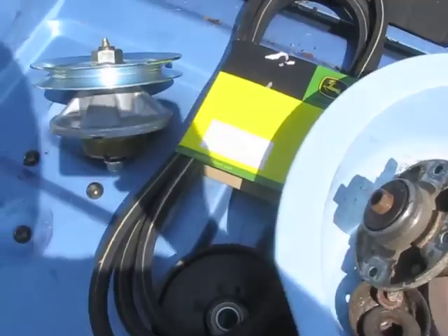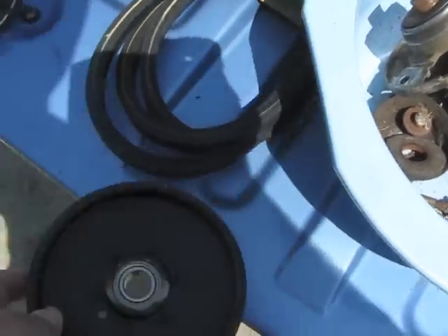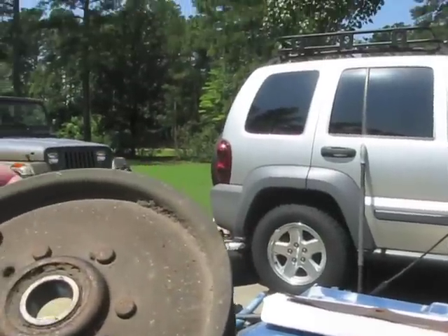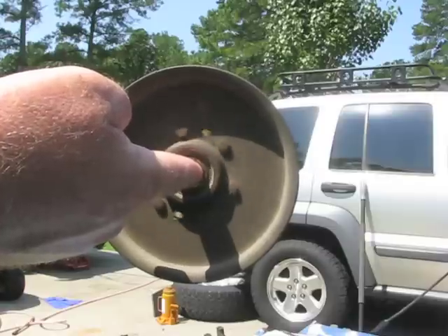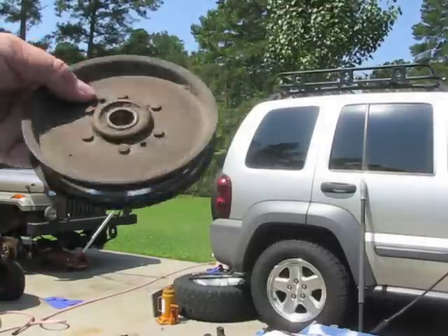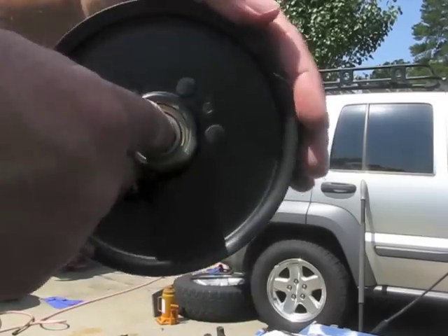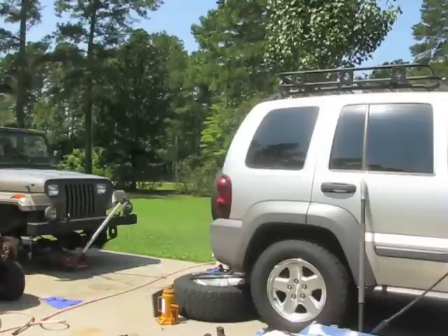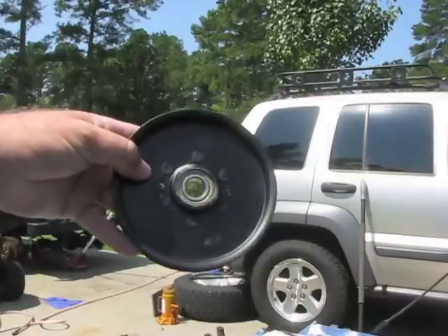Here's the idler pulley — my brand new, very expensive belt. There's the old blades sitting on top of the box of new blades, and the new idler pulley. I'll show you real quick what the old one was sounding like. As you can see, it spins freely, but it spins very rough and noisy. This thing would get scalding hot when you're mowing and make a horrible racket the whole time. Here's the new one — it doesn't spin quite as free, but it's nice and smooth. Being that this is the original, it's lasted from 1997 until 2012. If I can get that much life out of this one, or even half of that, I'm happy.